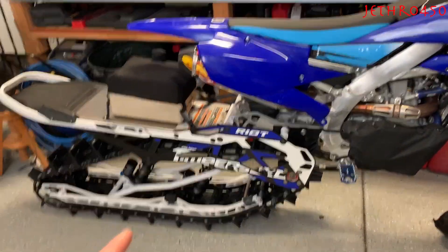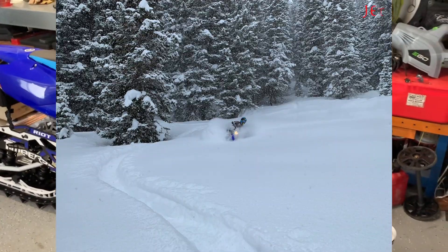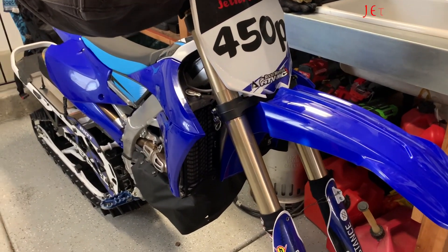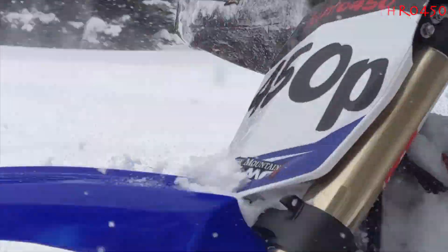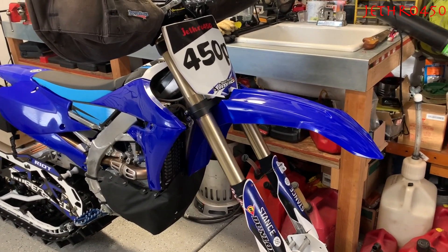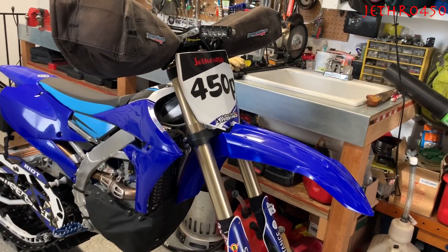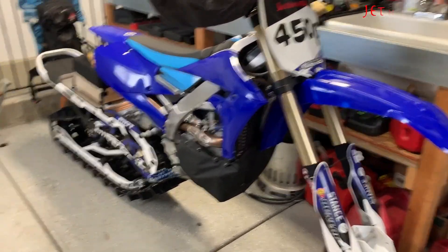Last thing I wanted to mention with the Riot: where they've moved the pressure point of the track is a little more forward, which means you don't need quite as stiff of forks as I've had in the past. I have 0.62 springs and 325cc's of 10-weight oil. My compression was at 7 clicks out and rebound at 2 clicks out — my Arrow setup — but for the Riot that was a tiny bit too stiff. I've backed compression off to 9 clicks out and rebound to 3 clicks out. If you're going to go snow bike-specific, having your forks valved specifically for snow biking is totally the way to go.